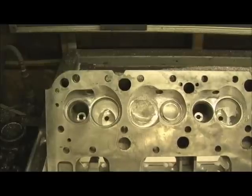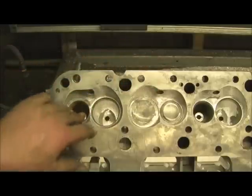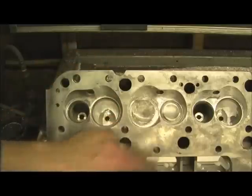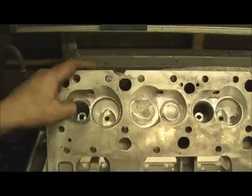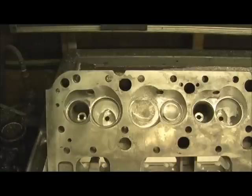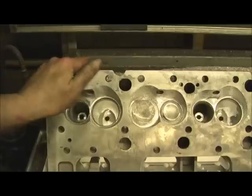I just wanted to touch on that to let you know what's going on. I'll take a minute to show you some differences. This side over here, which you can tell the kind of rough reflective — this is the stone. This is the first chamber with the 50-grit polish that I go in here and polish with after the stone. Man, this turned out really nice. There's no machinist ridges. This little bitty hump right here, the way I've got it laid back, it's not going to interfere — maybe with 15% of the valve in this area, it might hinder airflow just a little bit, maybe with the first 50 to 100 thousandths of lift, but I'll sacrifice that for compression.